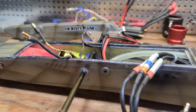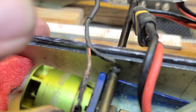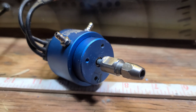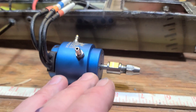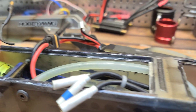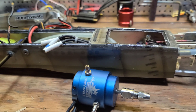I just got back to the shop, kind of looking at the boat here. Check out the wires — look how bad they are. When I plugged it in the second time and let it smoke, that's when the wires got smoked basically. The ESC is good — I hooked up the 3650 and the ESC is good. I wish I could put this motor in it but it won't fit, and I don't have any extra motors this size. So I think I may go with a Leopard Hobby 2840 or 2850 for this boat — something light, inrunner, powerful.